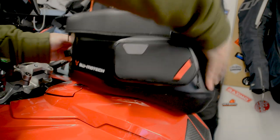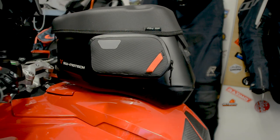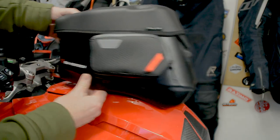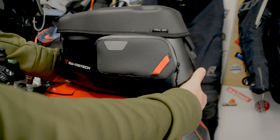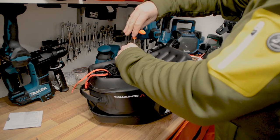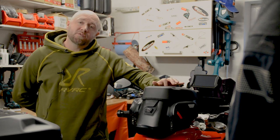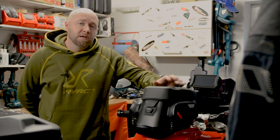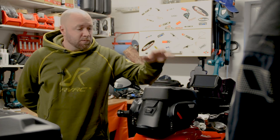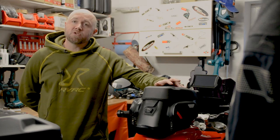Once it's on the bike you can test and adjust the position forward or back for your particular machine, ensuring your handlebars still have full range of movement. On the S1000XR, nearly fully forward is the best position. Once you've got the position right, remove it from the bike and fully tighten down the four screws. That's a quick look at and install of the Pro City waterproof tank bag from SW Motech. They also do a smaller version called the Pro Yukon waterproof, more suited to day trips, while this one is geared toward heavy touring. Links to SW Motech's website are in the description below. That's all for this week — I've been Sean, see you out there, take it easy.